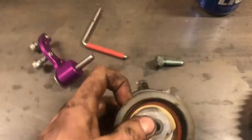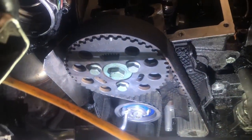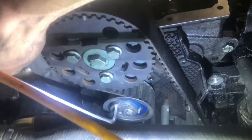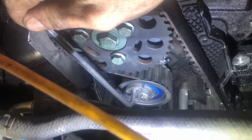As far as tensioning the belt, make sure this little tab is fully locked into your head. If you're doing the paint and pray method you haven't touched those three bolts on the cam, so you're fine to tension it. If you're doing it with the tools, keep the tools in but keep that cam sprocket loose so it can rotate where it needs to be as you take all the slack up on the back side. Then it's a matter of rotating it ahead until that little pointer goes into that window, and then you just tighten the nut.